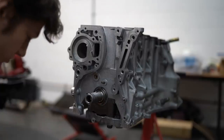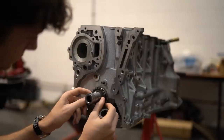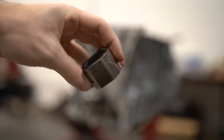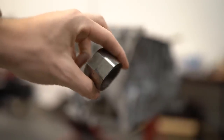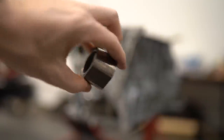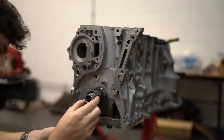Because my crank had work done on it, it was disassembled — there are just these two front parts. The timing indicator slides straight on like that. My oil pump drive actually has a tiny bit of damage. Because only one side of the drive really goes into the pump, I'm just going to reverse it so that the damaged side isn't being used. And that just slides straight on as well.